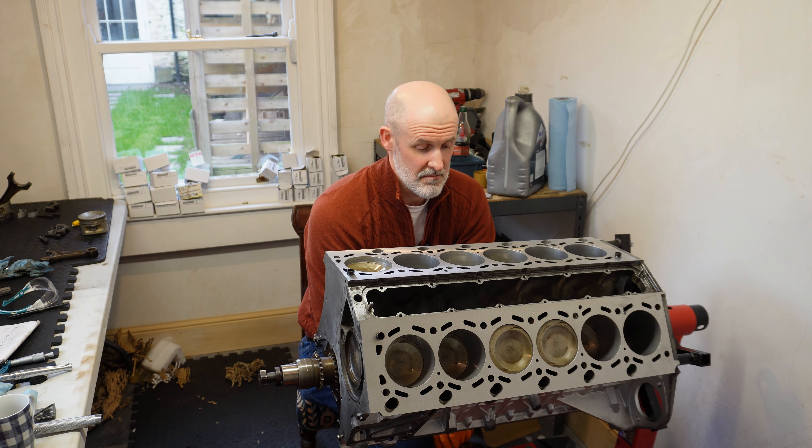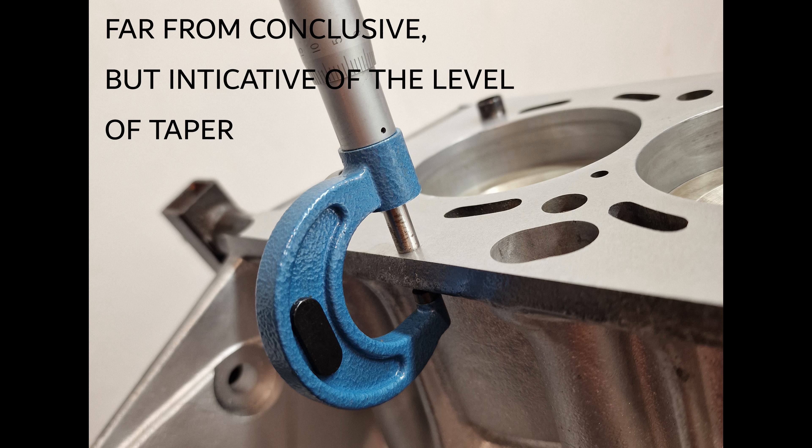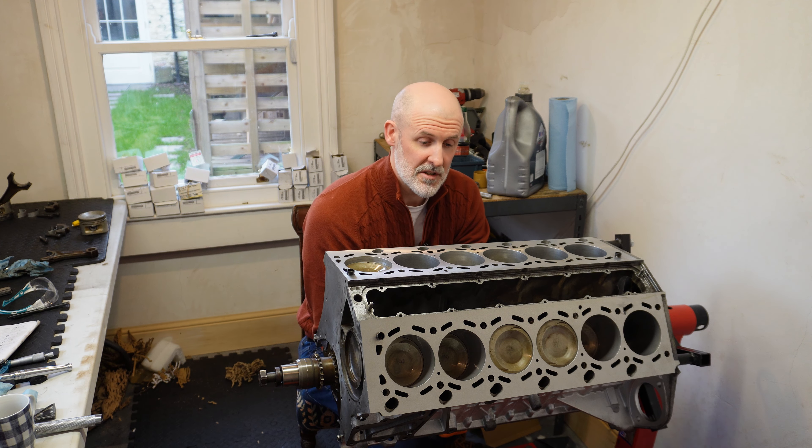In my last email I laid it all out - sent pictures, sent proof. I've measured the deck as well - you can see it graduate off towards the rear, the chamfers disappear as it graduates backwards. You can still see the original chamfers just about on the first two cylinders, then they just start disappearing towards the back. All the proof is there that the deck was machined incorrectly, and they've just stopped replying - they don't care anymore. I laid out all the costs of getting the piston crowns machined, new rod bolts, getting the pistons recoated, all the time involved in reassembling it - and that's when they stopped replying. Two machine shops now with substandard work, and it just leaves me between a rock and a hard place.